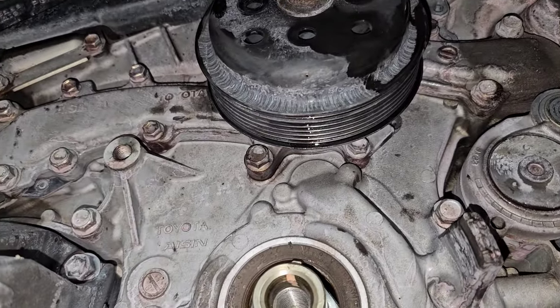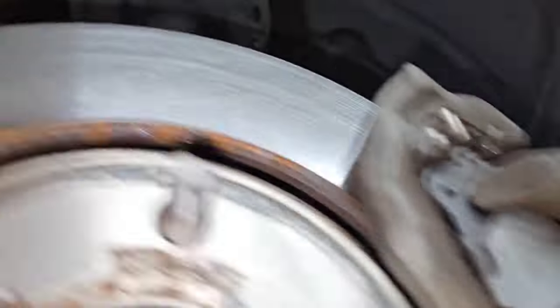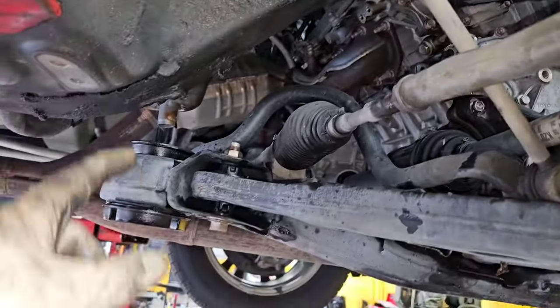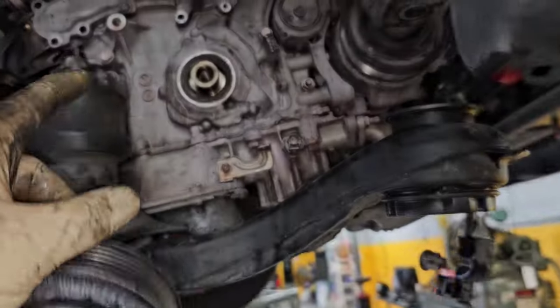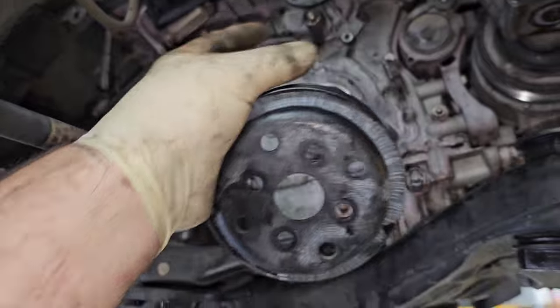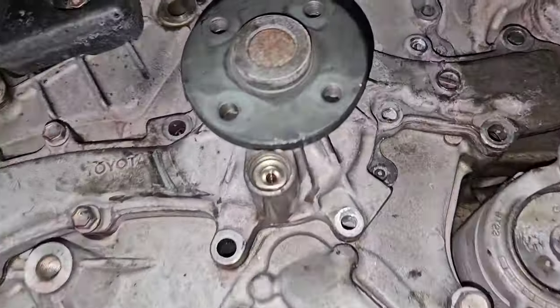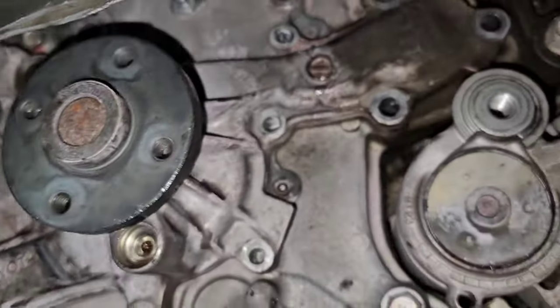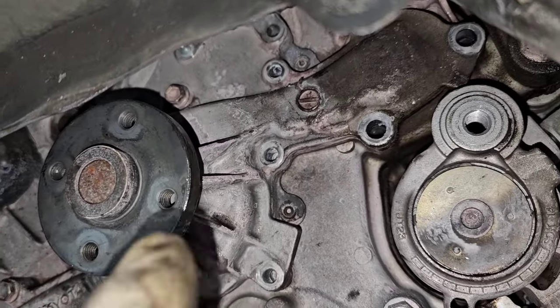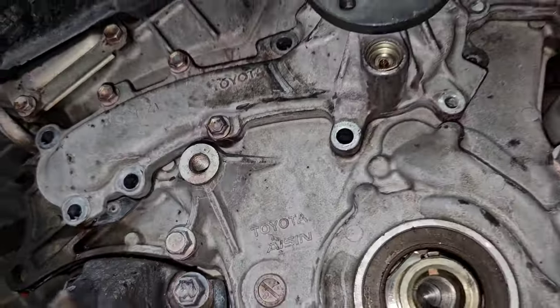Let's start taking some bolts out and see what we got. What I did was I disconnected the sway bar end link because I realized the cradle was at an angle and I couldn't get more of an angle out of it because the sway bar was hanging it up. So I took the sway bar end link off and was able to get it down further — now I can get the pulley out. I'm getting the bolts out; there's one up top there, a little bit of a trick to get to, but it's not terrible.